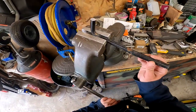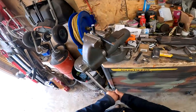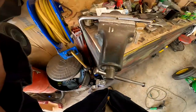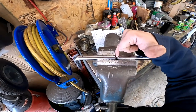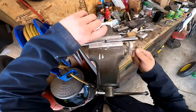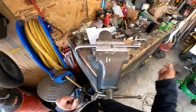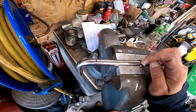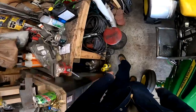The next thing I want to do is clean these up and get a nice little bevel on here so I can weld it together nice and solid. I got them cleaned up and you'll see I beveled these two. Now what I'm going to do is fill this whole thing with weld — I'm going to work around from the middle, do a bead, take this out, spin it, and just keep doing passes until I fill this whole thing. That will make sure it's solid again. With my TIG on 110 there's no way I'd be able to get down there, so that's how I'll do it.